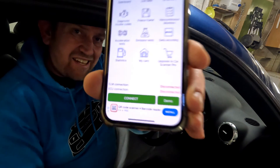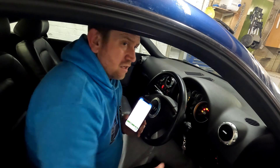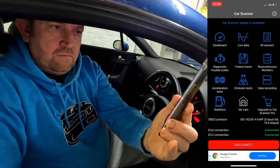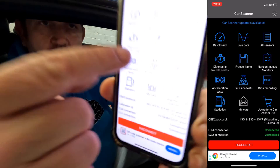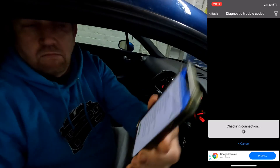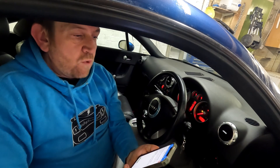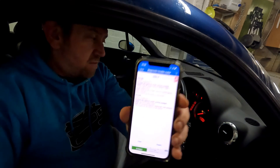Let's plug in the Bluetooth reader to the car. For now it will show as disconnected. I need to put some power to the car to get a reading, so I've turned the ignition on and now click connect on the phone — and you will see it's connected. We're all green. It also tells you the OBD2 type of connection. The important thing we need to look at is the diagnostic trouble codes, so if we click on that and then click read, it will scan the car. There we go — two codes have come up: P0130 and P1177.